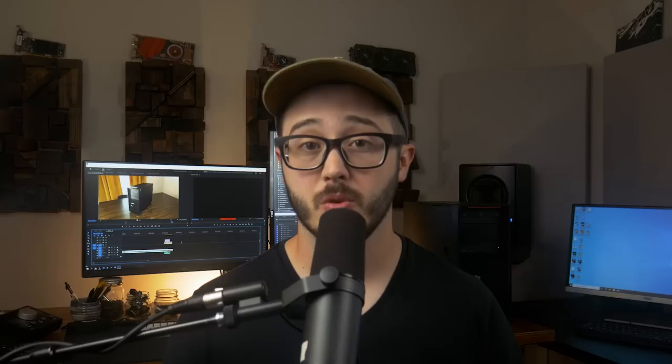If you're looking for a budget PC but don't want to be stuck with a 4-core CPU, your best bet would probably be to look into a Ryzen system. You can get something like a 6-core R5 3600, a B450 motherboard, and 16GB of DDR4 for around $200 used, but you'd still need to get a case, power supply, CPU cooler, and case fans — all components we managed to get in this system. That could easily start to cost more than double what we paid for the P310, although you would be able to easily upgrade to something like a 5800X3D down the road if you wanted a crazy fast gaming CPU.